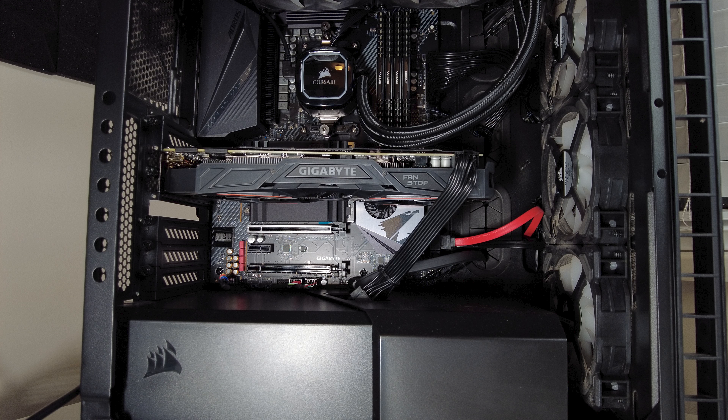Because your computer's layout is probably different from mine, pull up the specs or the instruction manual for your specific motherboard to locate a few things. The easiest option will be a reset button on the front or the back of your motherboard, so check for that first — basically hit that and you're done.